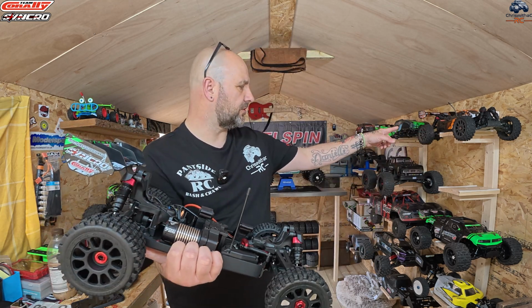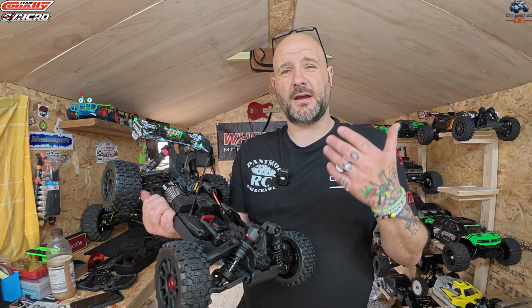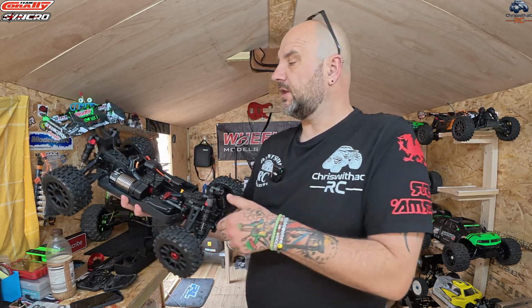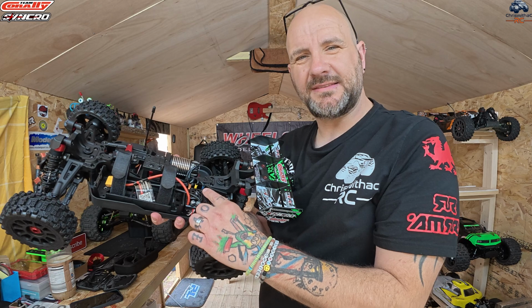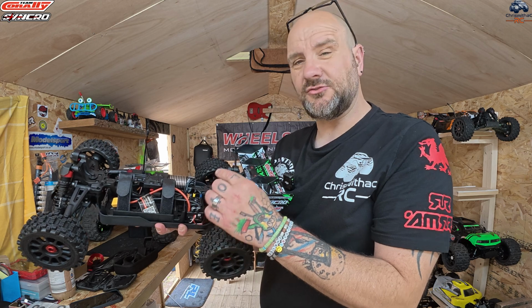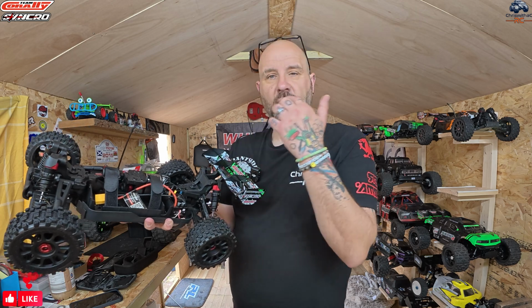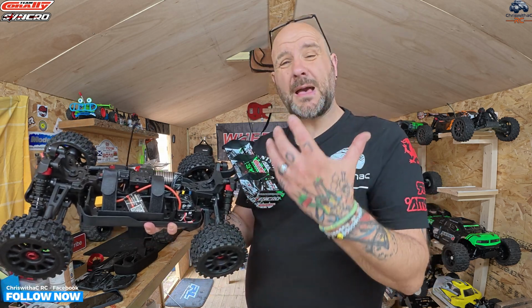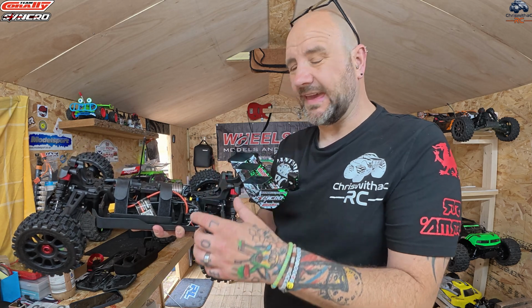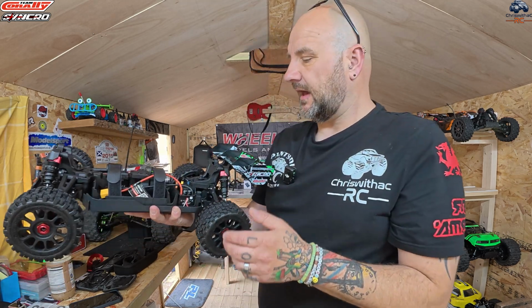I run it on my Syncro 4, on my Punisher. I've had that motor in one of my Technos previously. Good motor, good power, revs up nicely. You've now got a 10BL 120 G2 rebranded ESC, the Team Corally 2 Rocks 135. Now, that's a 135 amp ESC, guys, so it will cope with 3S, 4S, absolutely awesome. I, again, have used a different version of this ESC in other vehicles I own, and it's been blinding, honestly.